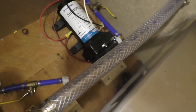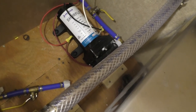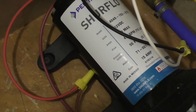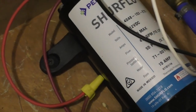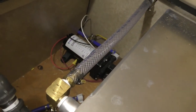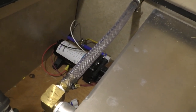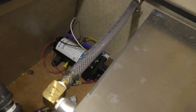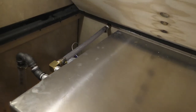As far as replacing the pump, you've got those two water lines, the two wire nuts — you just twist them together. Then there are four Phillips heads; that's the only tool you would need to replace the water pump — a number two Phillips head screwdriver, which is the most common size. Those anchor the pump to the deck because it does vibrate some and you don't want it jostling all over the place. Hook up your water lines first, then anchor it to the deck — it just makes it a whole lot easier than fighting the water lines with the pump already mounted. Hopefully this helps, but let us know if you have any other issues.